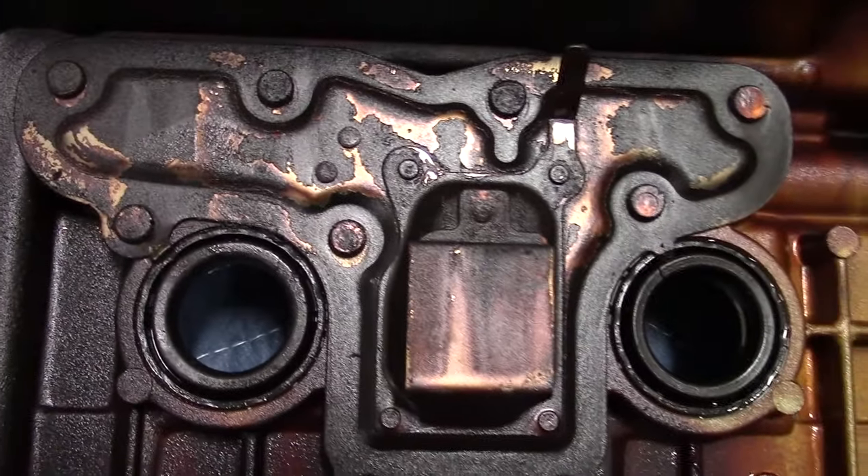Here's a close-up shot of the half moon and the camshaft cap installed back in place. You want to see some sealant being squeezed out when you install the half moon. I don't have the bolts in but you can see the camshaft cap in place there. At this stage I'm applying the extra sealant called out in the factory service manual — in the top left corner of the screen you'll see the locations. I apply about a nickel-size dollop on those locations. Here's a close-up showing the extra sealant applied at the half moons and camshaft caps.